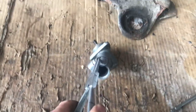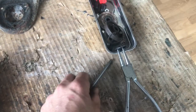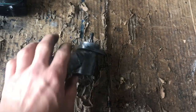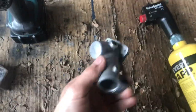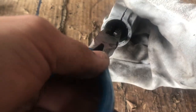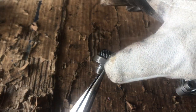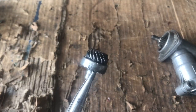Okay, we've got that one out there. The one in there is a bit difficult because you need some long ones to get down there and into it. Okay, so that's the circlips out. Now to get this one out I'm going to heat this up a little bit with a blowtorch — just to expand it a little bit — then I'll put some pliers down there and grab that bit and pull it out. Okay, that's been heated up. I'll put my screwdrivers down there. There we are — pulled out. That's the bearing and the teeth. It looks all right. We're going to clean that up and have a look.